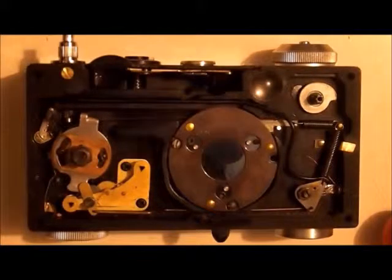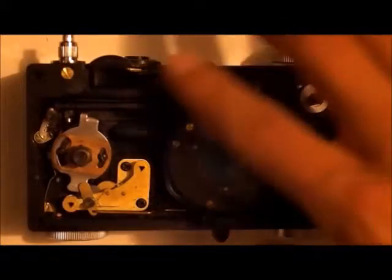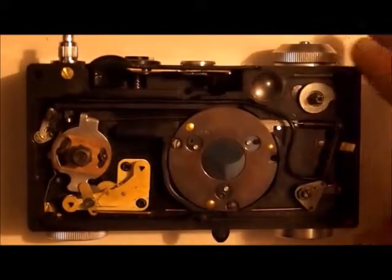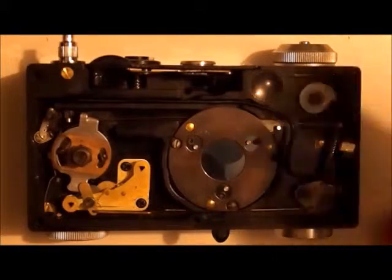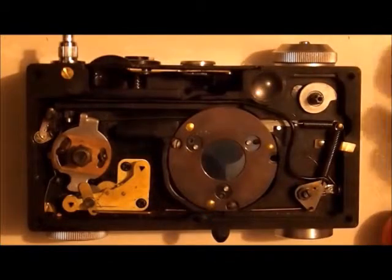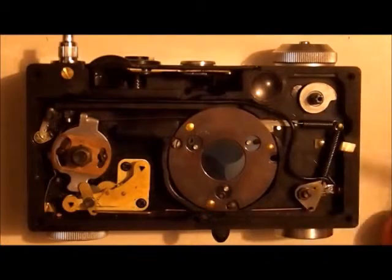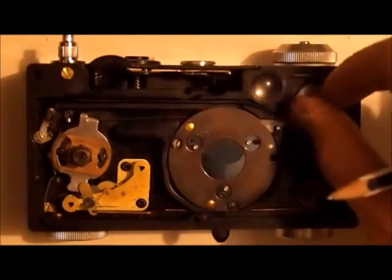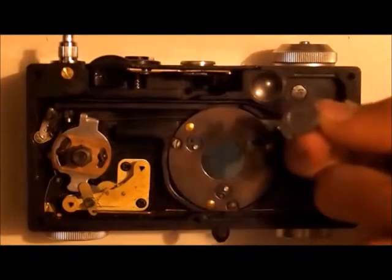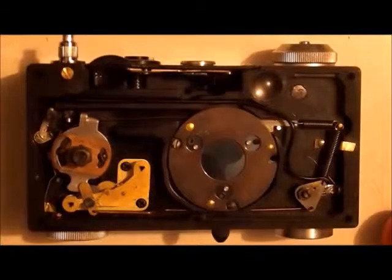You can see I have exposed all the internal mechanisms here, and you'll notice that all of these things are laying across the entire face of the camera. That's because all the mechanisms are just placed right here on the front end of the camera — everything else is just cheap bakelite plastic. I'll point out the main mechanisms here. But before you do anything, you'll see that this part of the shutter mechanism is like some sort of cam — you just want to lift that up and put that away. That's also part of the shutter mechanism.